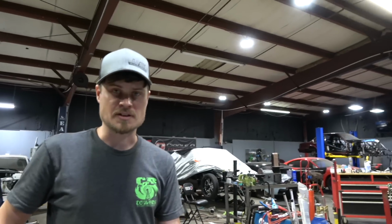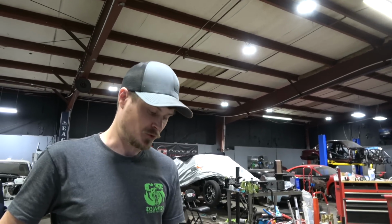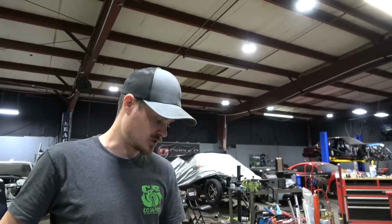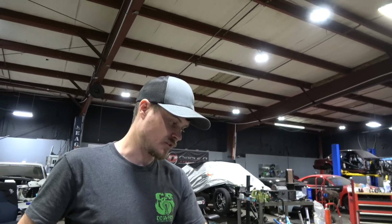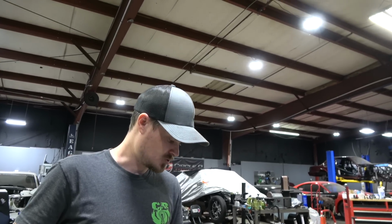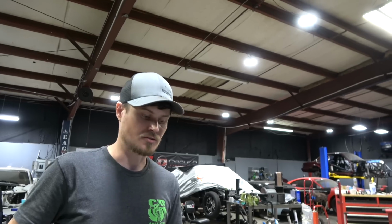These pumps don't like to pump air, obviously. They want to pump fluid. So what happens sometimes if you have this hooked up to your regulator is it can't overcome all the air in the system to open the regulator, so you'll never prime.